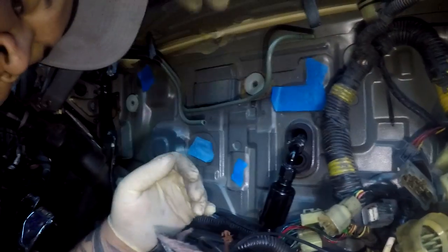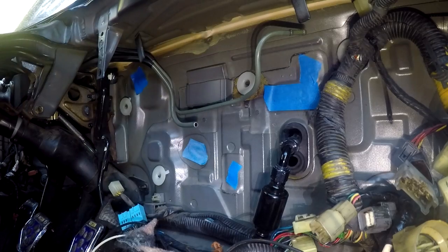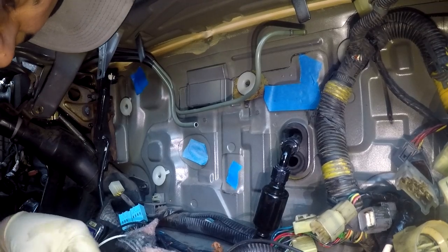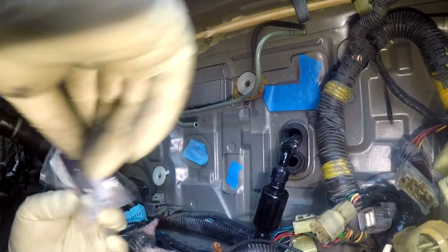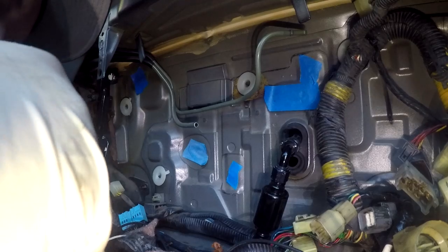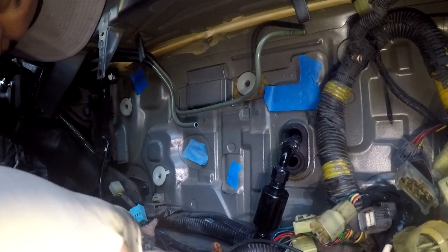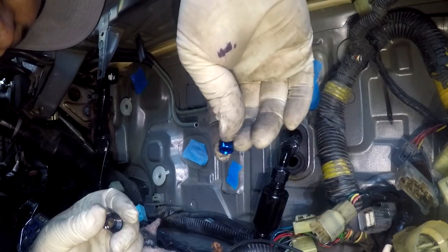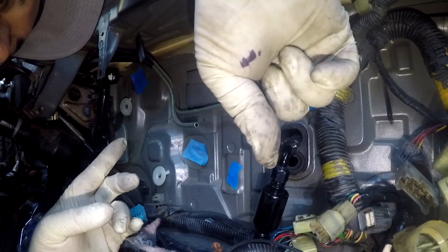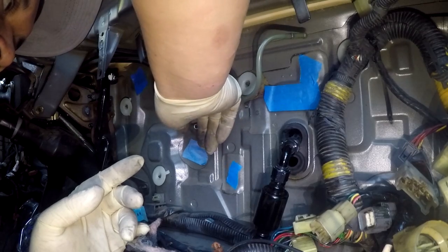Just like that. So like I've mentioned, you have two different ways to go about doing your fuel tuck line, converting your hard line to a -6. The first way was doing the tube sleeve version, which requires the -5 tube sleeve nut. I'm just gonna give you a prime example. I'm not doing it this route this time around, even though all my other cars are done this way. Here you have the tube sleeve, which goes in after you install the tube nut. So the nut goes on first, and then the tube sleeve goes on afterwards.